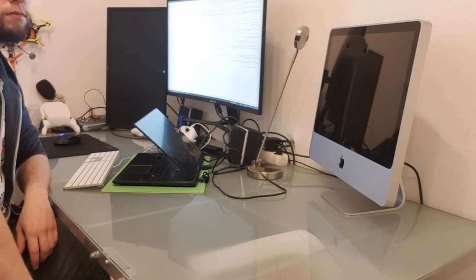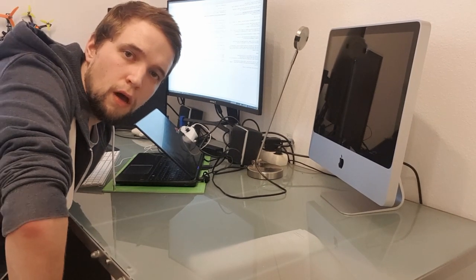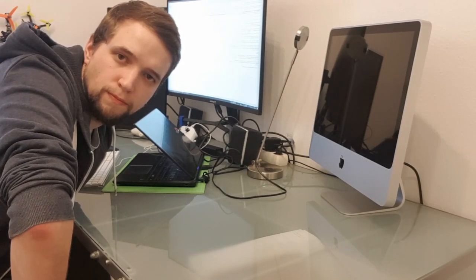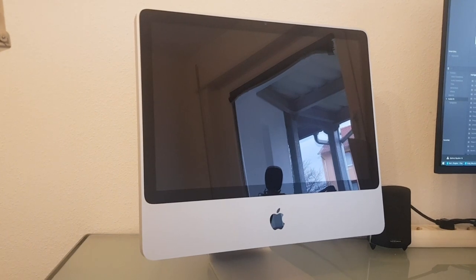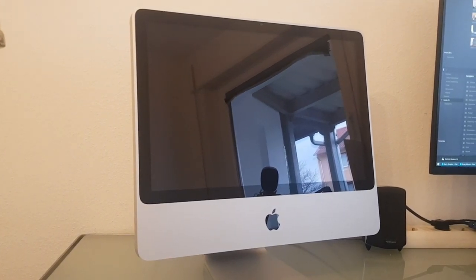I changed the HDD to a 500GB one from another iMac, but the HDD temperature sensor is not interchangeable between some iMac models, so the fans spin on high. All the time. I bit the bullet and set up the Mac with those fans on maximum. I even upgraded it twice.